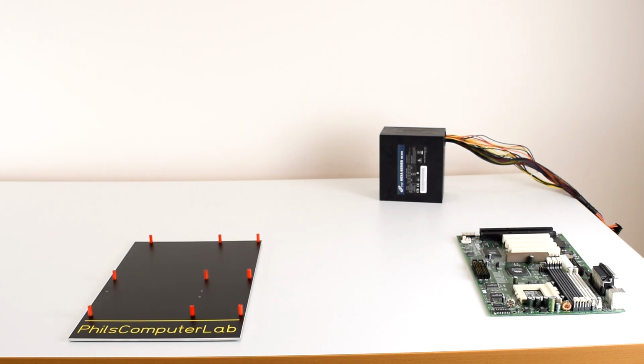The Super Socket 7 platform is a popular choice because it's very flexible. It's great for DOS, it's great for Windows 98. It bridges these two generations of DOS and early Windows 3D gaming. Because of the cache tricks, it's also flexible in terms of slowing it down and running 386 and 486 era games at the correct speed.